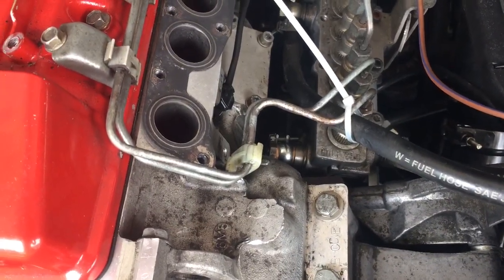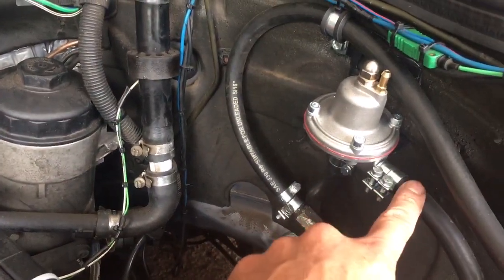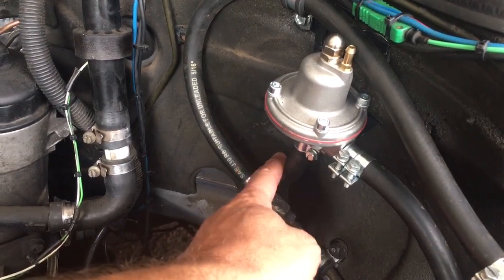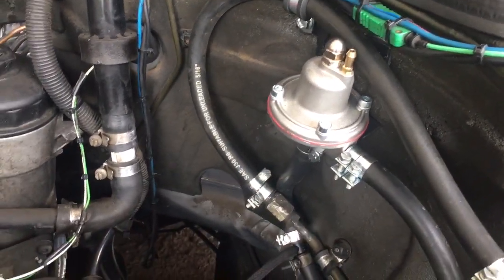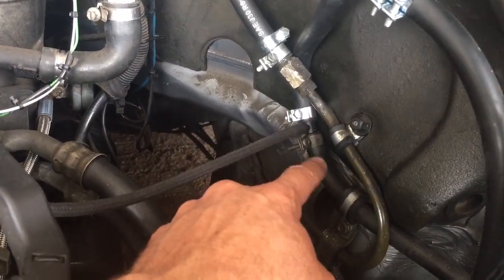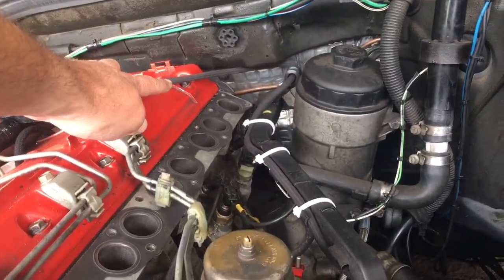So there's no longer a relief valve in there. The return fuel goes back up a pipe here into this fuel pressure regulator, which comes in here and then chucks the fuel out the bottom to return to the tank. That's the low pressure end, and you can see I've put the leak-down hose into the low pressure side — that goes straight back to the tank. The other leak-down hose comes down the back there, nicely P-clipped out of the way.